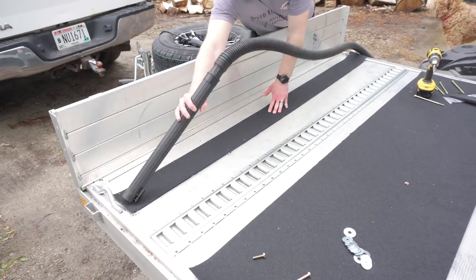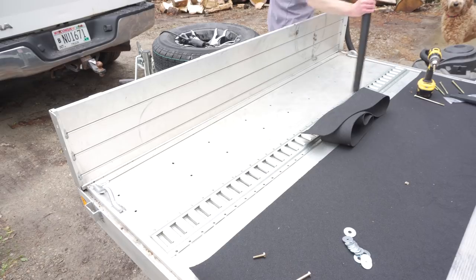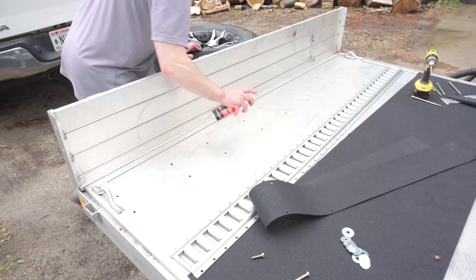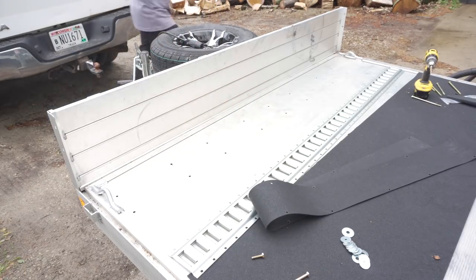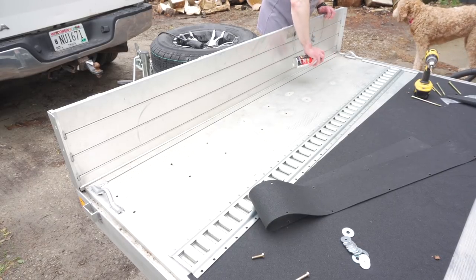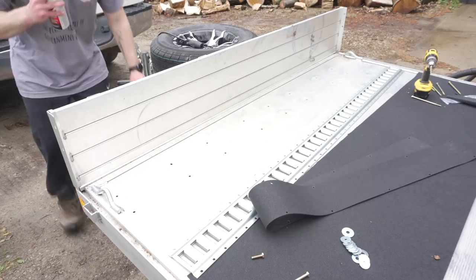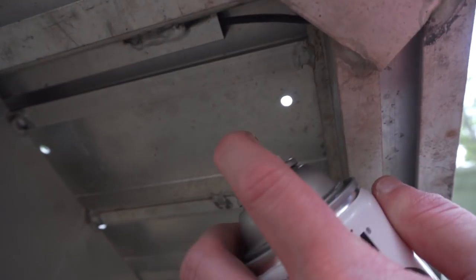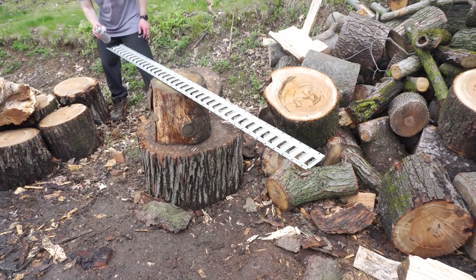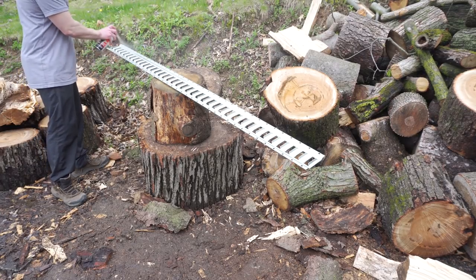I went ahead and picked up all the aluminum shavings — they're sharp, and I managed to get one stuck in my finger, so be careful. I'm spraying each hole with a clear Rustoleum spray. We've put fresh holes in the aluminum and the e-track, and the spray will help seal those back up so the holes don't lead to rust later on. I've got rubber between the metals, and I'm spraying paint wherever I made a fresh hole, including the cuts on the e-track and the drilled holes.